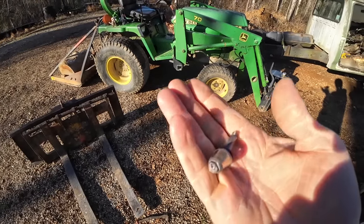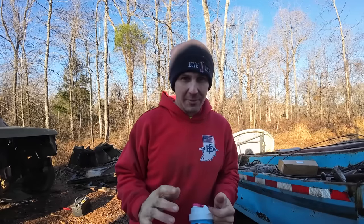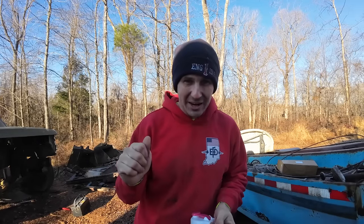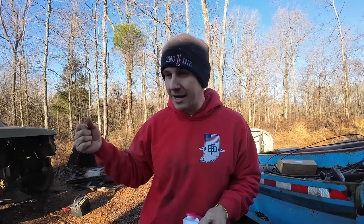Same thing happened again, and I fried both my tips. That outlet is only a 15 amp outlet, and it keeps tripping. So, lesson learned there. I definitely have to pay attention to the airflow and make sure I've got a good power supply for that compressor and good air coming in. That is the big difference maker, what I've learned so far. Because if I don't, I ruin a tip instantly.